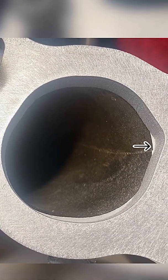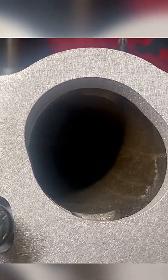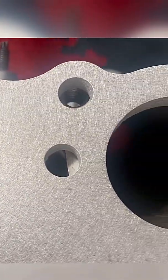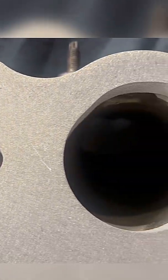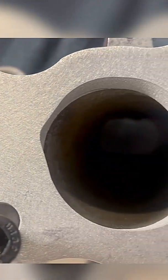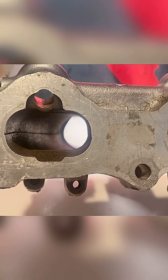Right here we're going to see cylinder one. Everything you see you're going to match to the adapter flange and vice versa. On this side you're going to match all of the runners to the adapter flange, which is not much — very minimal. On the other side you're going to match the adapter flange to the GE runners.